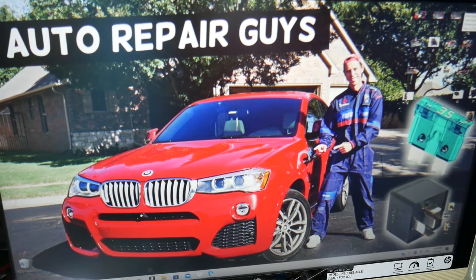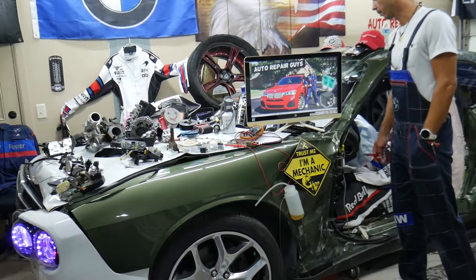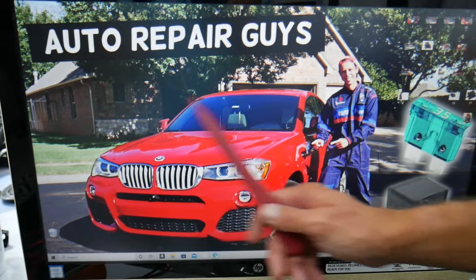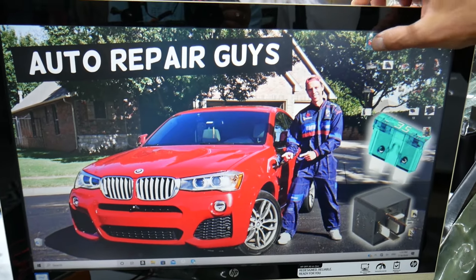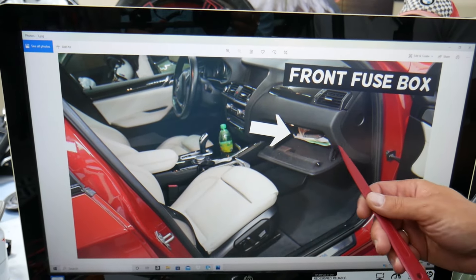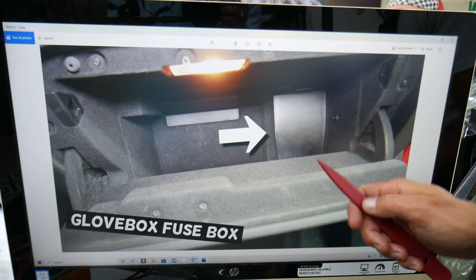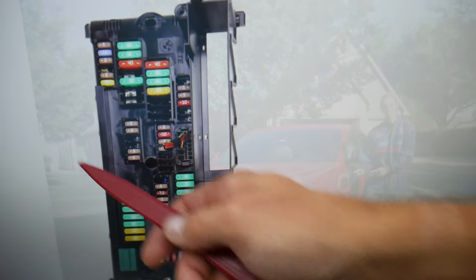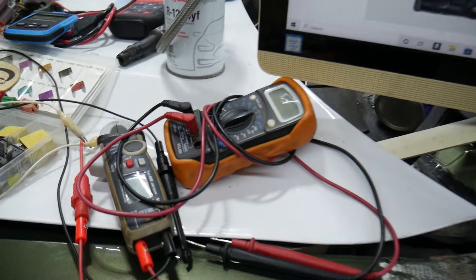For the fog light switch fuses and relays, we need to check multiple ones, because they are known as light fuses and work across multiple fuse boxes. The first fuse box we need is on the passenger side. Open the passenger door, open the glove box, empty the contents, and in the very back on the right there is a cover — press that tab, pull the cover out, and behind it you have the fuse box with the layout shown here.